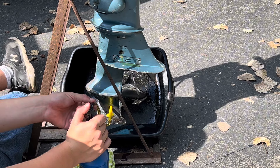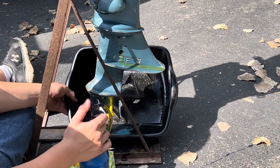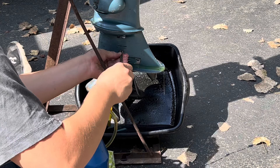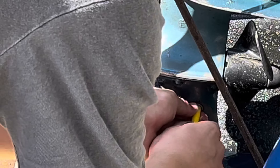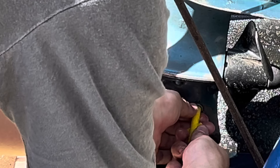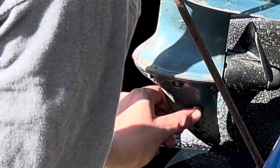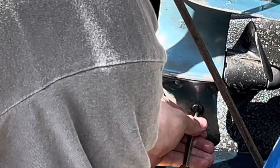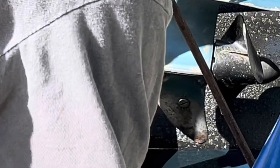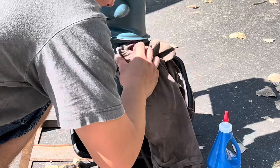You can see here my lower unit is getting full. As I pump it, the oil comes out of that top screw hole — you see that? So that means I am full and ready to insert the top screw back in. Now go ahead and unscrew the fill pump from the lower unit. Once it's removed, put your thumb over the hole to put the screw back in. Make sure it's nice and tight. Good. Now go ahead and clean up all your materials and wipe down the motor free from the oil residue.